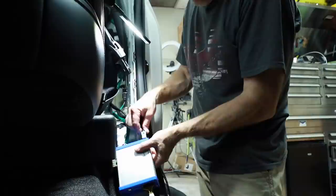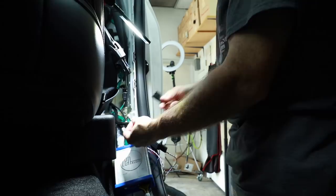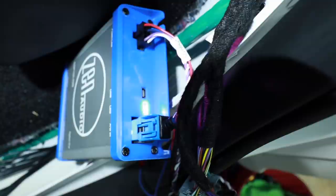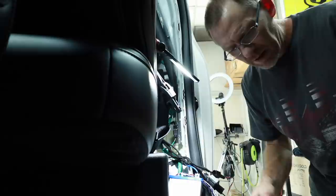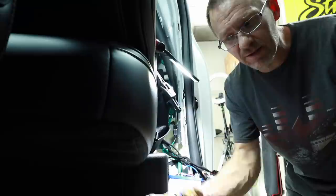Let's get over in the car and plug this in. Plug in the USB blue connector first, the big gray speaker harness, the smaller black main power harness. As soon as you do that, you'll start to see blue and red lights flashing, which is what we want to see — that means it's communicating. It's reading the system and then it goes orange, which is more of a yellow. According to the instructions, that green, red, or yellow means normal operations. I'm going to turn the key on, turn the radio up. We'll have no sound, but it'll put voltage into the RCAs, which is what we're looking for.